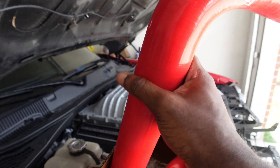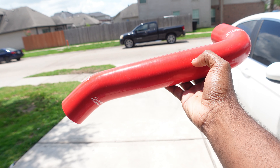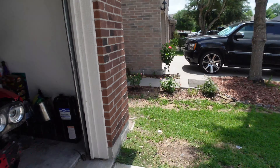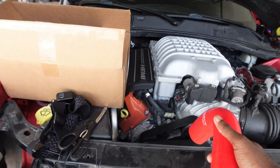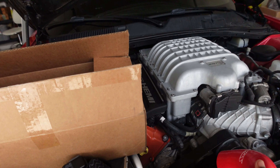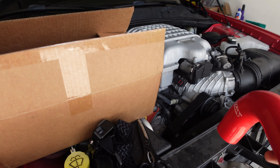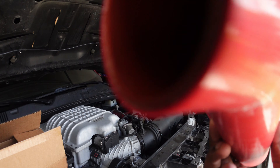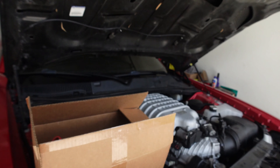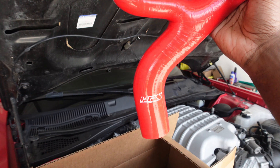This is an HPS cooling hose. This one is supposedly way better — silicone is supposed to be way better than the stock one. Y'all know I had problems with that; it kept ripping. That's because the pump is close to the pulley so it shreds through it. But this one also keeps the cooling more efficient. So that's the upper one, and this is the lower one.